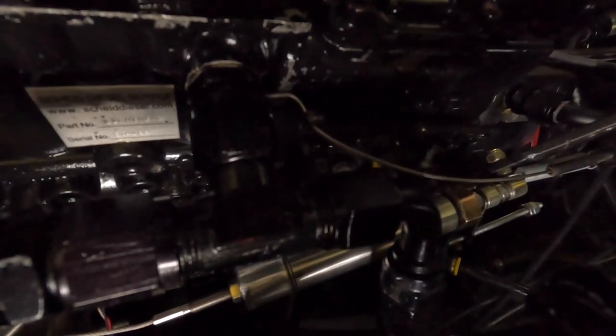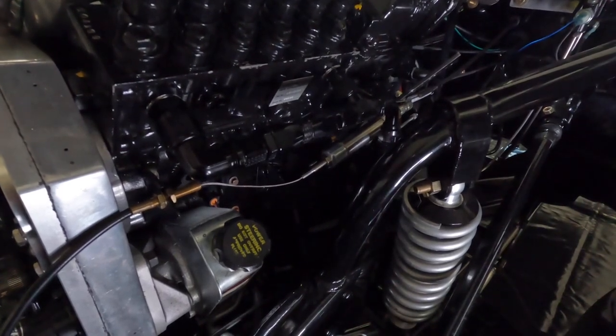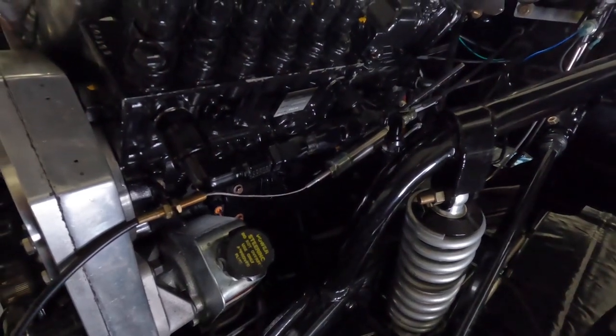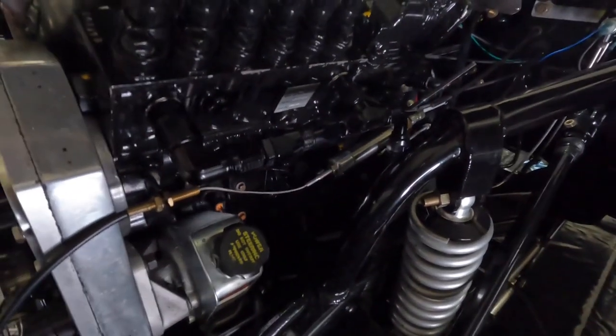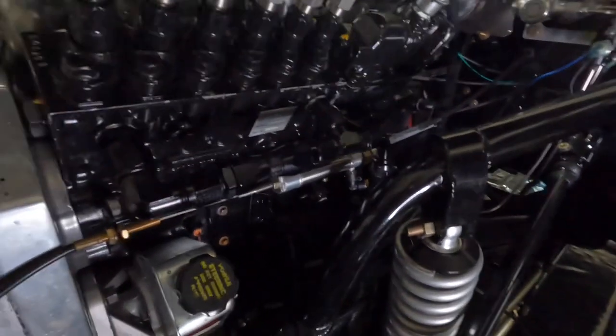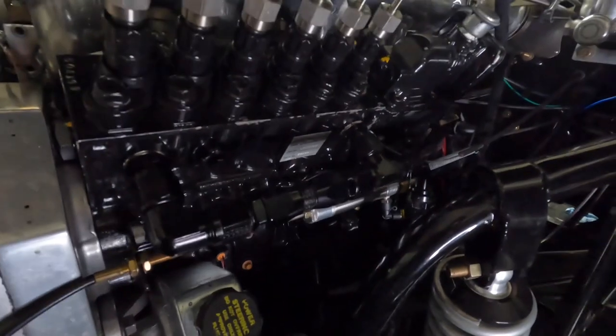Now I'll show you exactly what happens when attempting to stage. Right now we have air pressure — nitrous — going to the valve; it is fully operational with full throttle travel. You can see the pump lever is all the way to full throttle. Let off — we have full range of operation back to idle. Now hit the throttle again.